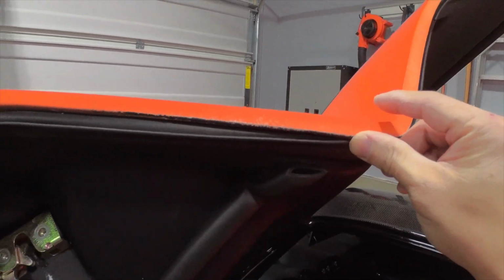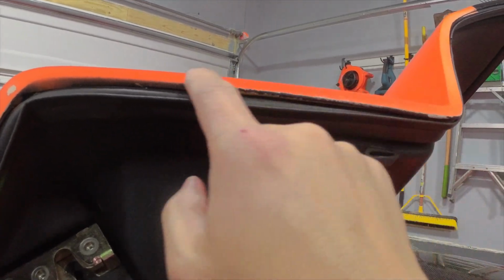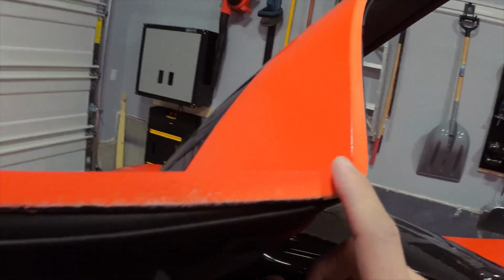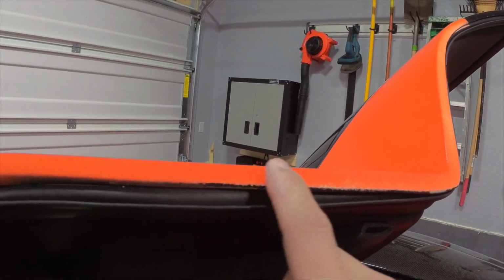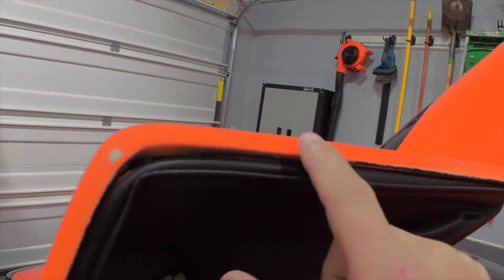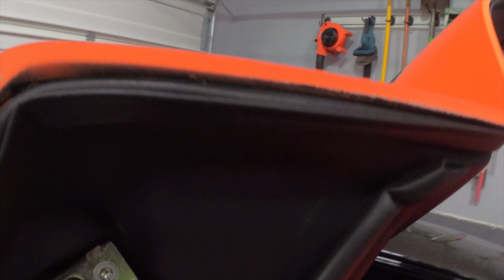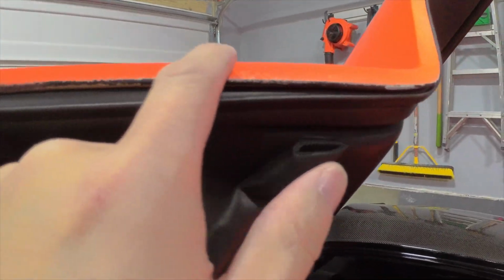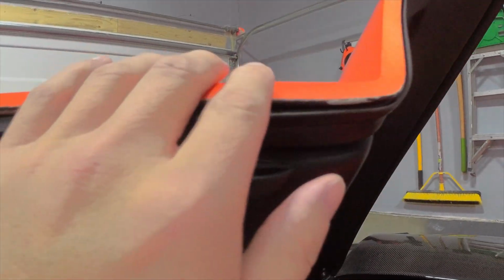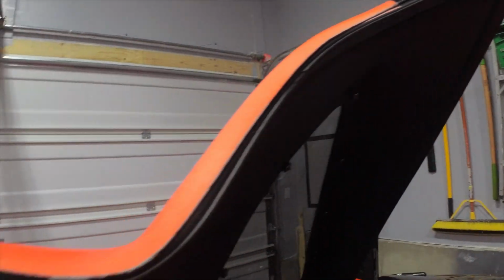One of the byproducts of that, however, is that the dip is not nearly as smooth here as it is on the standard part of the panel. That's because when you overspray the PDS, as I did here, it tends to atomize and basically dry before it hits the surface, and that creates little ball formations, so that's why it's really rough here. There's a ton of texture here, but I figured having texture but getting some color here was better than having no color at all.